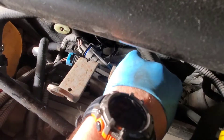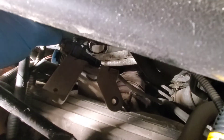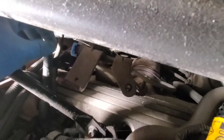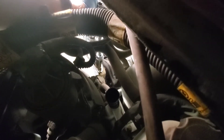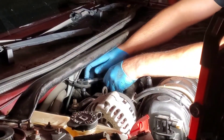This is our wire for our oxygen sensor. The wiring harness is here — there's a tab that you need to pull on the top side, pull that out, and then you can disconnect it. We place the socket on the extension and slide it on so the wire has a space to go. Righty tighty, lefty loosey.